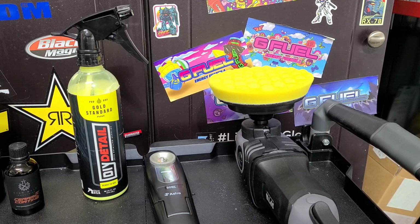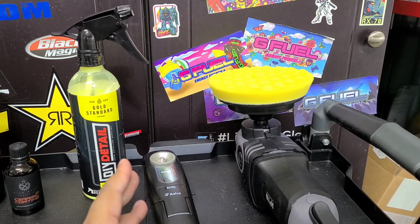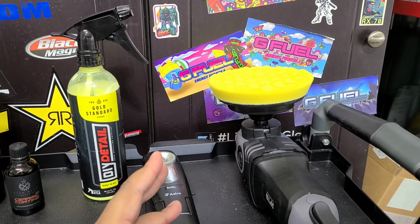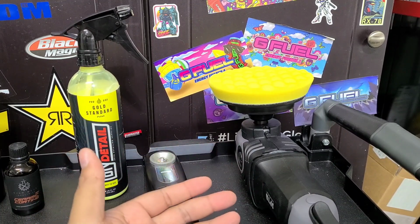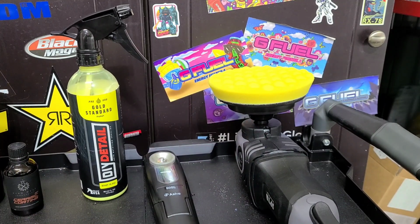So let's get over to the spot on the hood we're going to do. Normally I would do a test spot, but because this paint is already in such good condition, I'm not going to experiment with any test spots. Generally, if the paint's already really good, all you've got to do is a finishing polish and a finishing pad. If the paint was worse and I had to do a whole one-step, yeah, I'd do some test spots. And just so you guys know, the difference between an enhancement and a one-step: with an enhancement, you're just trying to get gloss. With a one-step, you're trying to remove as many defects as you can with good gloss, all in one step. If a car needs a one-step, I'll do it. If it doesn't, I just do an enhancement. Obviously, you can't one-step a paint that's already good. So let's get over there and take a look at this. Now, again, this is white paint, but I'll do a tape line. We'll see if we can see any difference in polishing it.